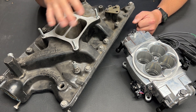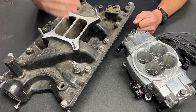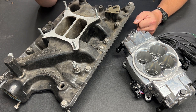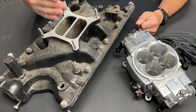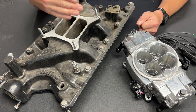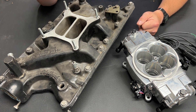The second issue is this project is all about torque. Everything I've done on this build — with the exception of getting a little more high-RPM with the camshaft — has been to maximize torque. My '62 Galaxy is a big, heavy girl and it needs all the torque it can get to move down the road. The biggest difference between a dual plane manifold and an open plenum manifold is where you produce power and torque. A dual plane gives you way more low-end torque but not the same overall flow; an open plenum performs less effectively on low-end torque but runs into higher RPMs.